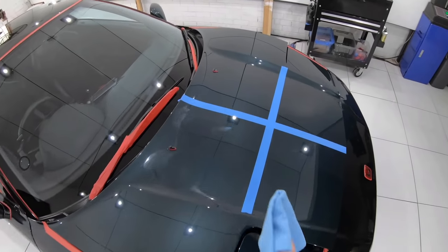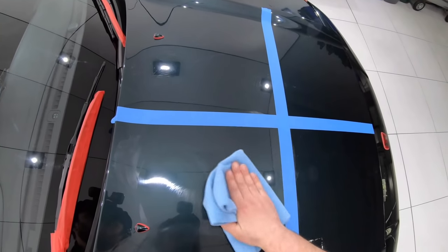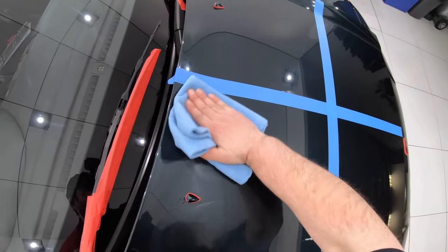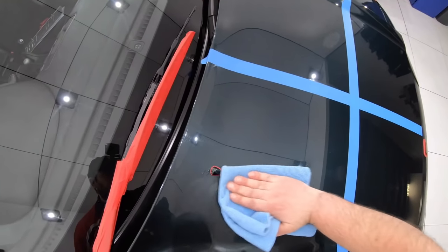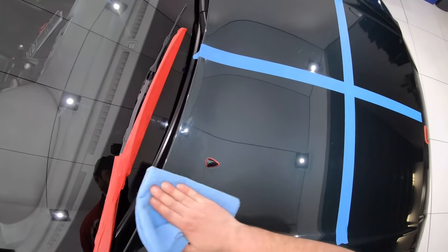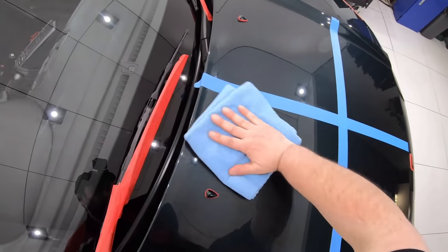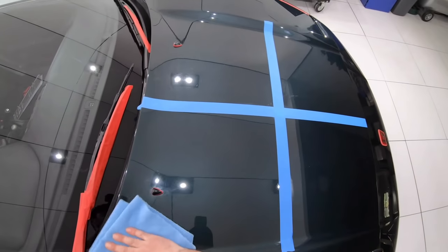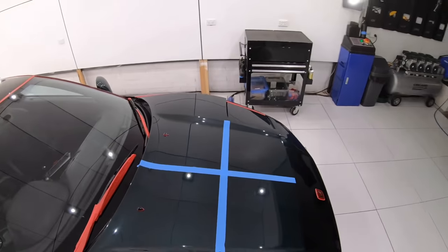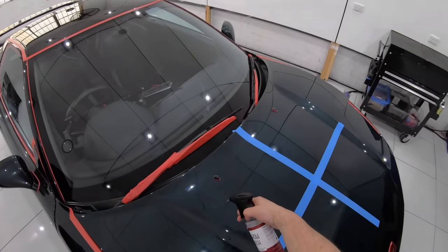Also important to note is your wipe off. It's really best to firstly remove the polish residue with a dry microfiber cloth and then follow up with your panel wipe cleaner to remove the lingering polishing oils. True paint correction is about having the ability to cleanly and accurately assess your results. So if you have polishing oils filling and masking existing defects, you'll be misled into believing that the paint looks better than it truly is.